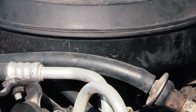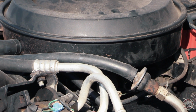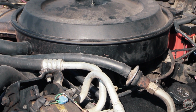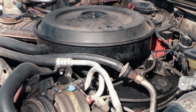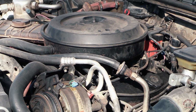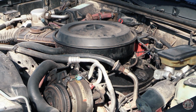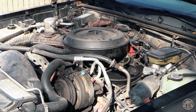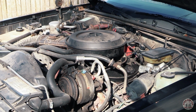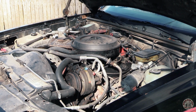It may have had 180 horsepower when it was new, but if you notice from the startup, this engine is getting a bit long in the tooth. It burns a pretty good amount of oil, enough sometimes to foul a spark plug, and it was not cared for by the previous owners. I once had to replace the intake gaskets and filled a small coffee can with sludge and hard carbon deposits from the lifter valley alone. No doubt this is partly due to the garbage oils of the 1980s, as well as unrealistically high oil change intervals suggested by the Chevrolet manual.